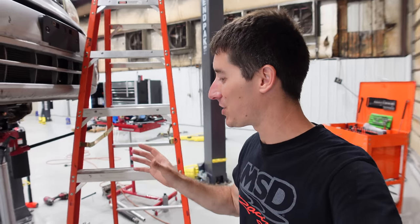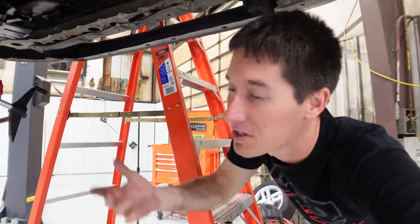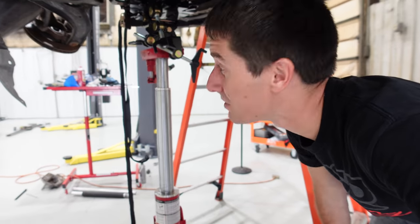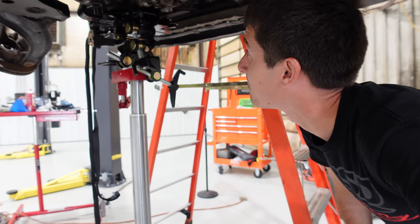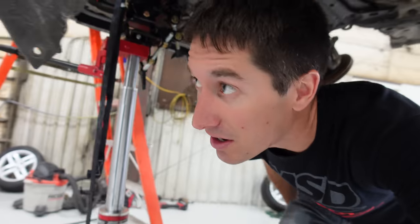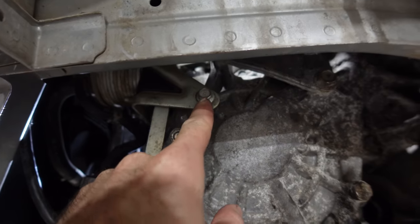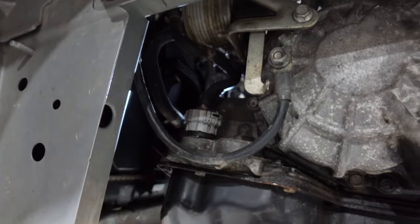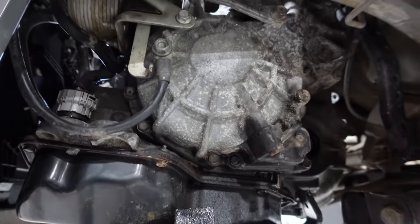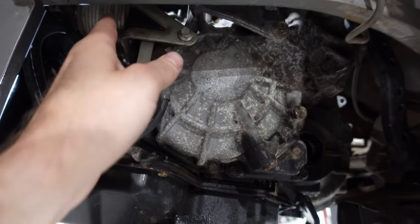And we're back. The transmission is finally mated to the engine on round two. The bolts are in. So now it's basically just reassembling everything. So we're gonna put the axles back in, start mounting everything, start wiring it. I do have the main connector on because that one's kind of tricky. So I've got the ground strap on, one bolt in the cooler and the main connector and that upper speed sensor that sits underneath the cooler. That's basically the stuff that's impossible to get to after the cooler is actually mounted.